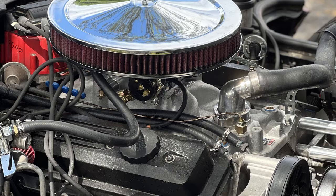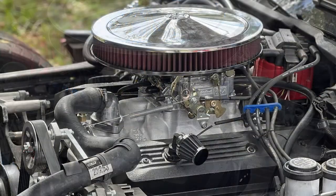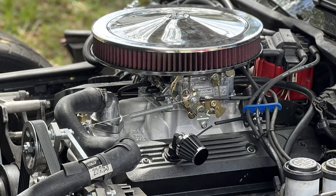Also, a lot of people will tell you that you need to cut a hole in the hood. Now there are ways to work around it. In my case, I have a 2-inch air cleaner, which is pretty low profile. However, it still does bump the hood in a couple spots, so you have to cut the snout on the carburetor for your air cleaner down a little bit. You might have to dremel some of your hood on the underside or maybe dent your air cleaner, but overall you can make it work without cutting a gaping hole in the hood and putting a scoop on it.